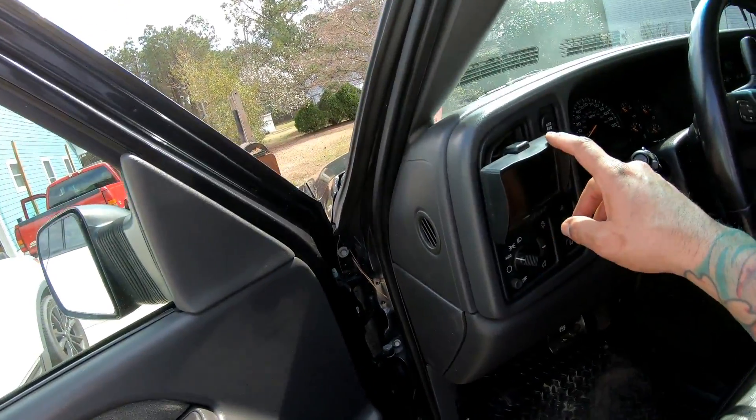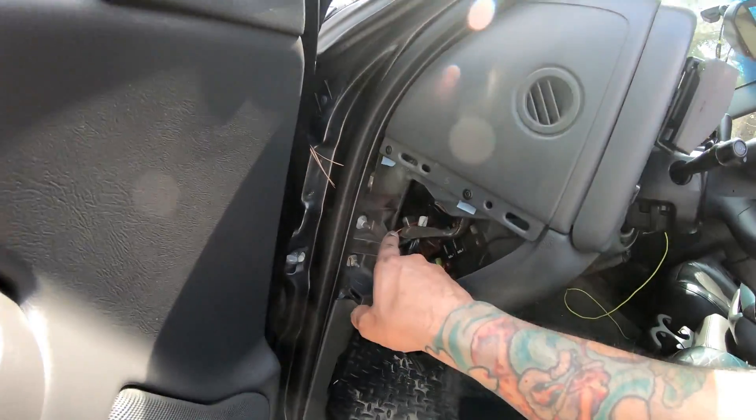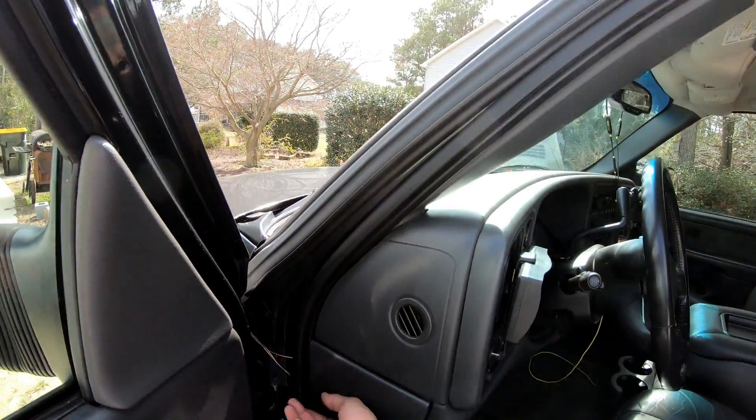Anyway, I got one system on my truck — I think I showed this one time — but on the spray truck I got a wireless system. Here's the backup camera. Basically all it needs is a power supply, which I hooked up to a fuse on the load side. It is protected and grounded, with a 10-amp fuse. I made a big boo-boo yesterday though — I hooked up my power wrong. I'll show you on the back. Because it's wireless, I'm not gonna be able to show you directly.